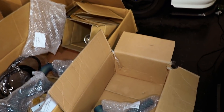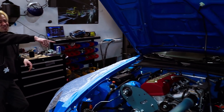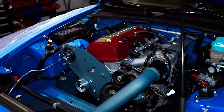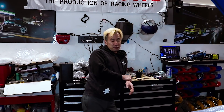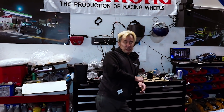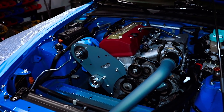Was this kit made for right-hand drive first? What about the AC line? I think the AC line might be in the same spot. No, definitely not — that's where the clutch master and brake master go on the RHD. Everything is literally mirrored. This kit was originally developed with HGS and Evasive. It was developed for the Japanese market car first, then they developed the US version with Evasive. There used to be two different part numbers, but they were able to combine them into one that fits both.